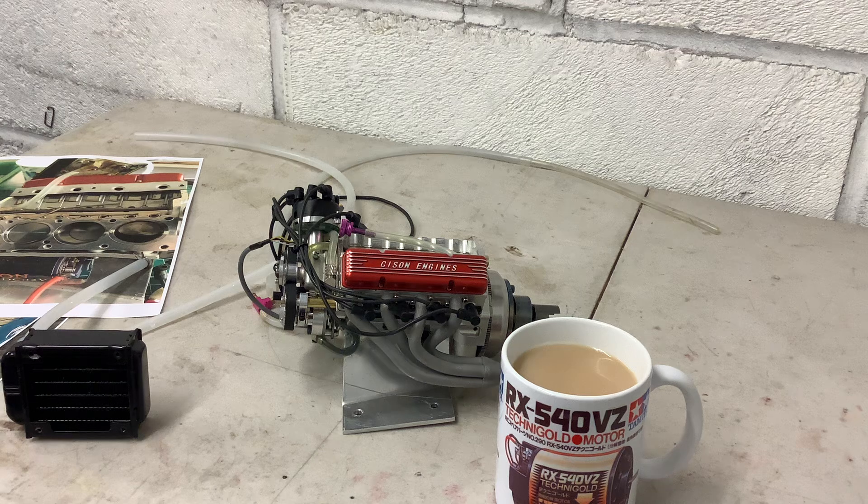So I hadn't run it up — I thought I'd see how it fits in the boat first. I went over to a friend of mine on Sunday, made up a table, and it wouldn't start. I found out I had the timing 180 degrees out, so as soon as we put that round the right way, she fired up, sounded okay, just making sure it runs alright.